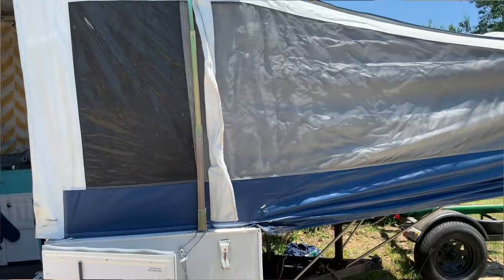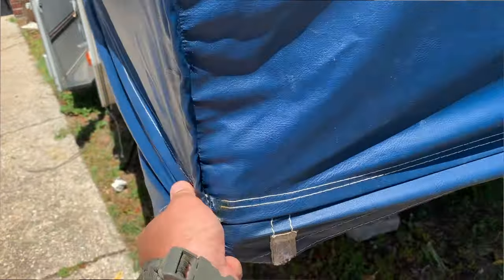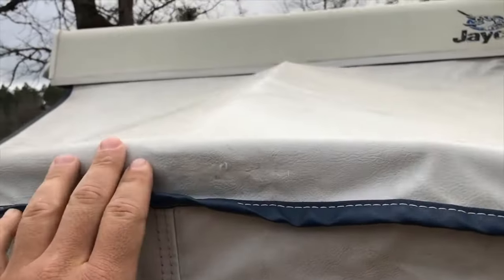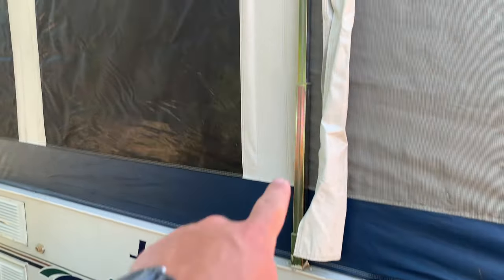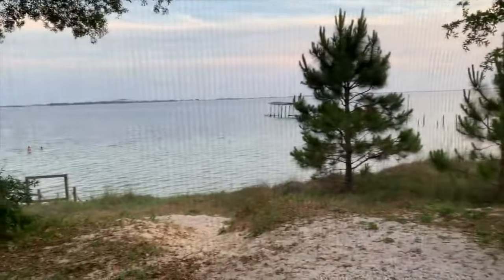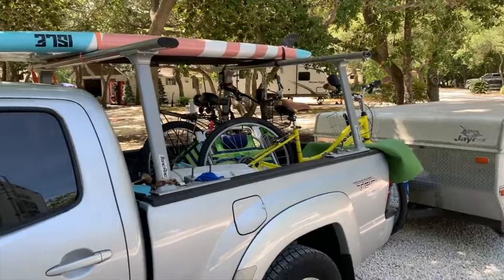Do a quick rundown of your canvas. Walk it around and see if it's got any tears. When you're popping the camper up and down, sometimes it'll get tears. The mosquito netting can get cut too. I've used Shoe Goo to fix canvas problems — if the tear is small, it'll make it watertight and still allow it to flex. For netting, I've sewn it up with fishing wire and put a little super glue on it. They also make tear repair packets. And don't forget to check your gas lines — start up your grill before you go out, because air can get in and it'll take a while to start.